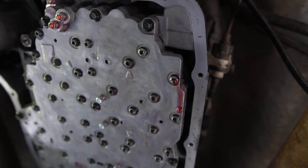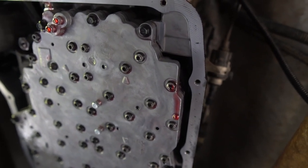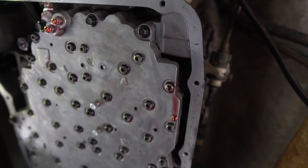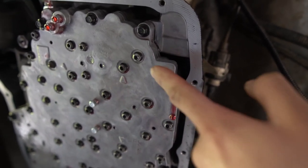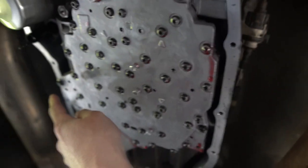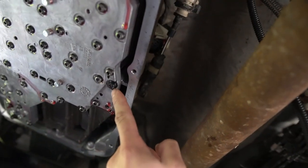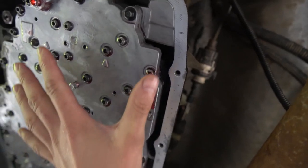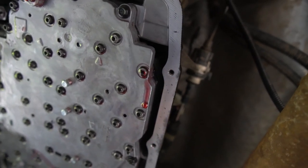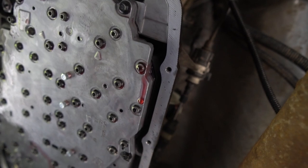This is what you're going to be looking up at once you drop that filter out of place. After that you're going to have six 10mm bolts to remove to get the valve body out — they're right along the edges, three of them there, one over here, one back here, and one on the side. Support the valve body just like you did the pan when you drop it so you don't drop it and damage it. Take it to your clean contaminant-free workbench and go ahead and start to disassemble.